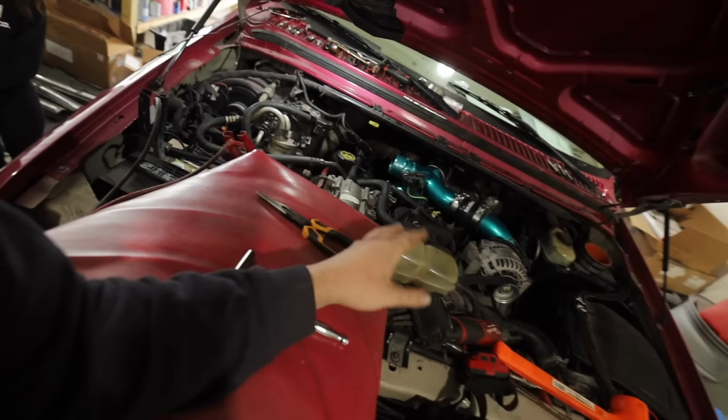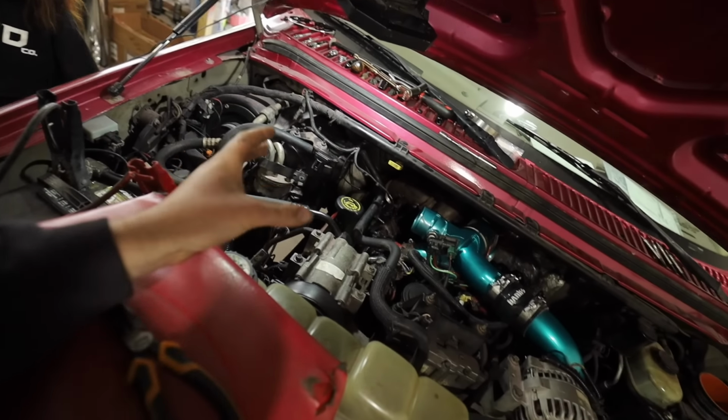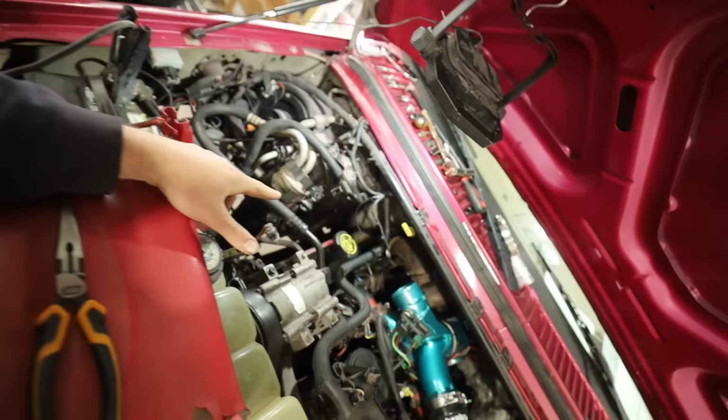Alright, because that glow plug took so long yesterday, we literally just called it a night after that, and plus, if you do something like this, you need to clear the cylinders. There's nothing wrong with letting it sit overnight. Honestly, a lot of the tech sheets recommend if you're at that point in the night where you could just crank it in the morning, let it happen, because a lot of it will actually seep down, and thus giving you less to expel out of the cylinder.